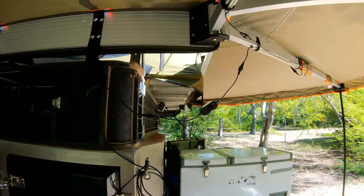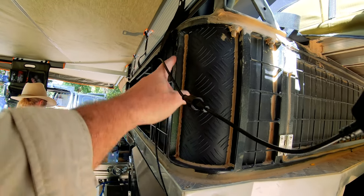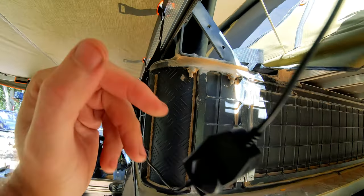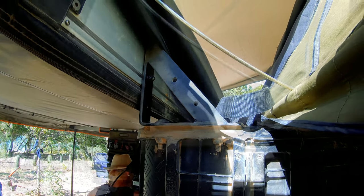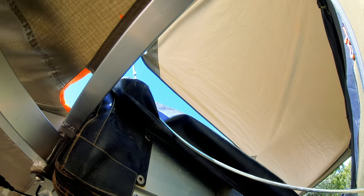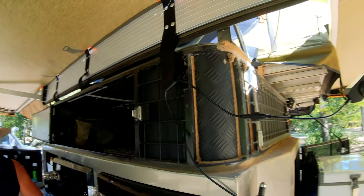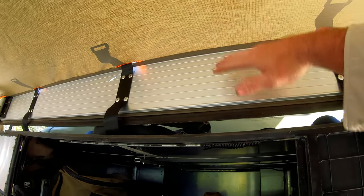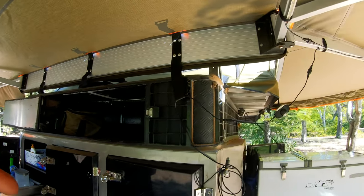While on the topic of the awning, I mentioned in a previous video just before we changed the skin — the factory Oztrak position — the old one used to sit here off the side. So I've just bought some Bunnings brackets, welded a back brace on it because there was a bit of wobble in it and I didn't want it to break. Moved it back 50 mil, and as you can see up there, that means the awning rain will just drop straight onto the awning at the front and at the side as well. That'll improve the weather through the thing. I know that's been a common question — especially water coming through this part — but now it's set back and with it dropping onto about here, that's just going to save any water. Basically no water's ever come in there anyway in our experience, but it's essentially fail-safed it.